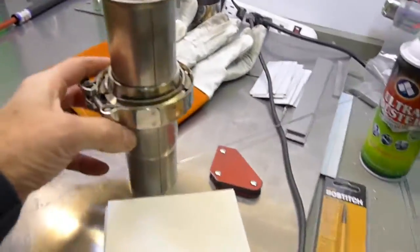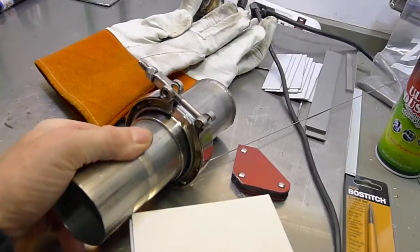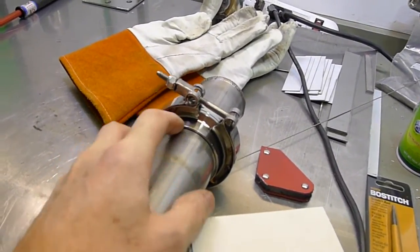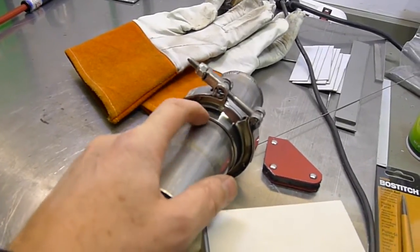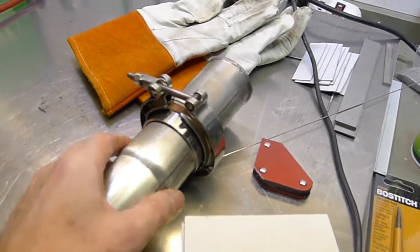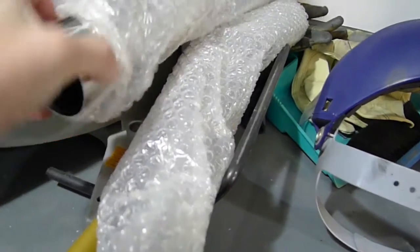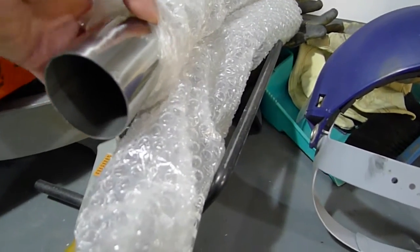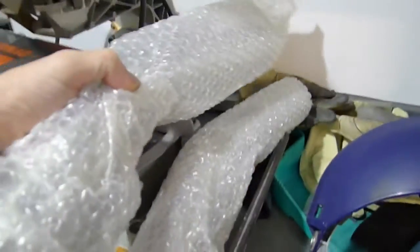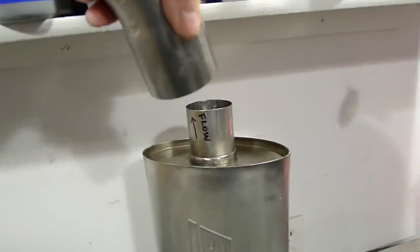This is the V-clamp, and it's kind of hard to see — I should take it apart. But basically there are two different shells that you can weld around the collar on each end, and then this clamps over the two of them. So you take two tubes of exhaust and clamp them together. What I'm doing here is I'm going to use a 2½-inch pipe for the tailpipe. These are 30-degree bends — two of them — and I'm going to cut them and make... this is the 2¼-inch that came from Tectonics that goes in the end of the muffler.